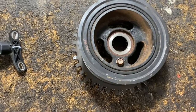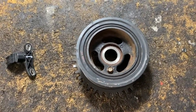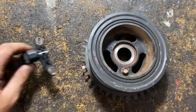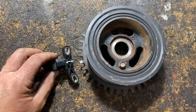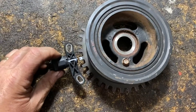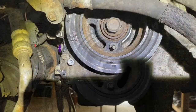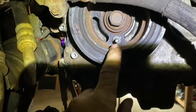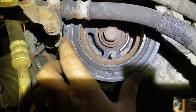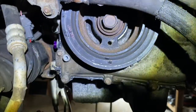On a 2010 Mazda 3 with the 2.0, this video is basically how to align the cam and crank sensor. Watch the other videos for how to align the cams and the crank in top dead center. A lot of people miss the crank sensor step. If the sensor wasn't set correctly, it'll give you a code, hard starting, or it won't run right. This way you put it right back to factory.